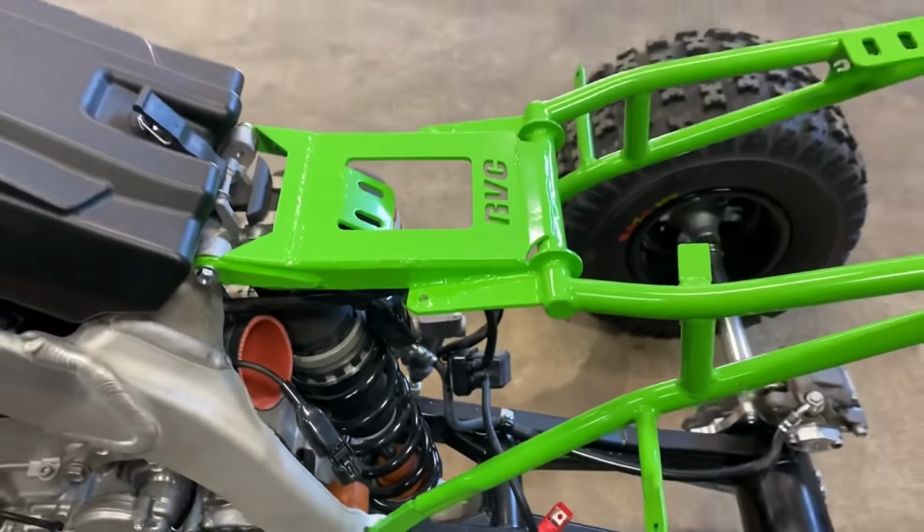Now guys, our kit comes with a seat post relocator bracket. So more or less, this just lines up the seat post correctly for this style of seat. So we did some trimming on the pan. We got this drilled and installed. To do that, we just pulled some staples out and more or less peeled the foam back, got it installed. So there's a quick shot of that. I'm gonna go ahead and staple this back on.